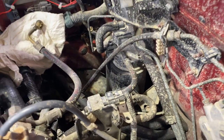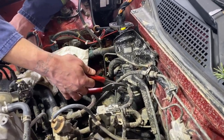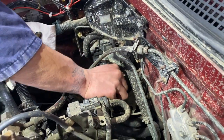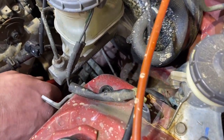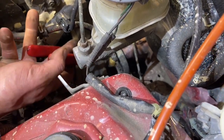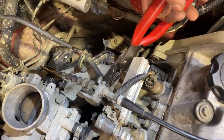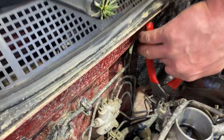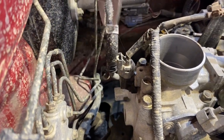We plugged the fuel line, which we believe is a filter. Now I'm just going to pop off this evap purge hose, and right down underneath your brake master cylinder we have our fuel return hose, super low pressure. Just gonna pop off this clamp if we can. Take it right off up by the intake here, because that is easier done. Since we're right here, we're just gonna pop off the vacuum line that goes to your brake booster.